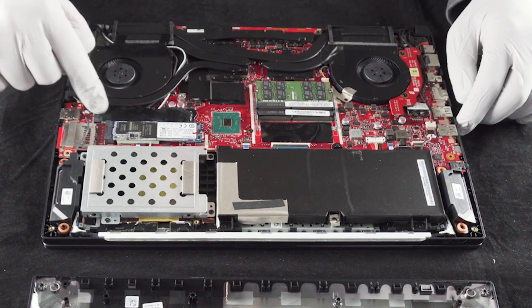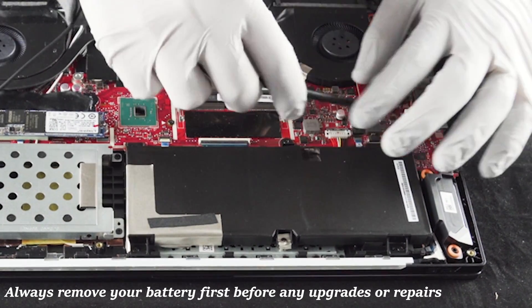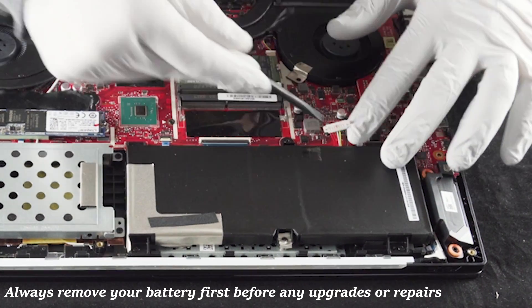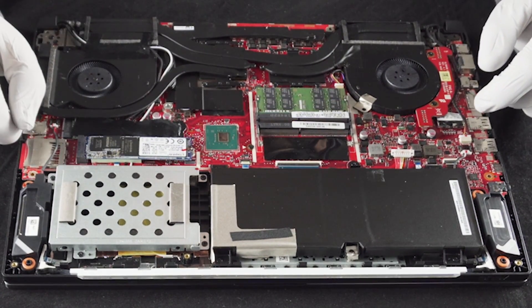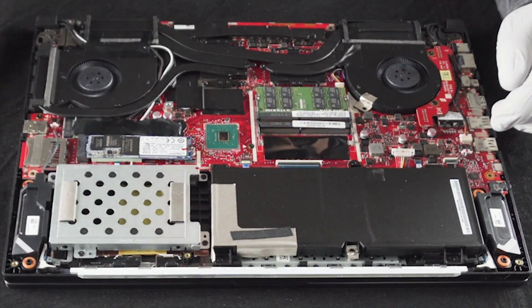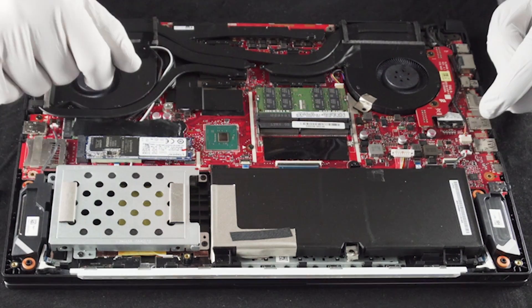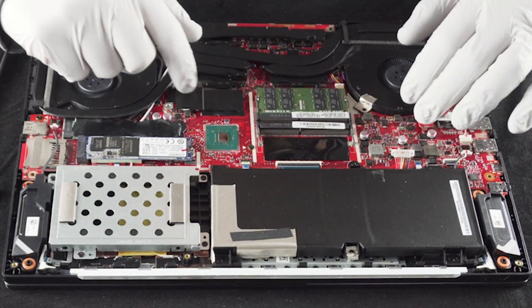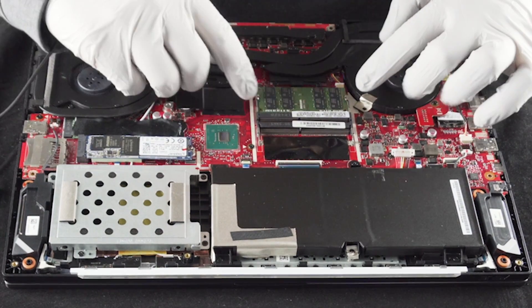Looks like our Wi-Fi is covered up by fabric tape. All we're going to be doing today is upgrading the memory. We're going to go from this single channel configuration — it does have a little clip on it. As you can see, it's in a single channel configuration. This is how Asus and a lot of manufacturers this generation are shipping laptops, and it seems to cause major performance issues in games, particularly in CPU-intensive titles. What we're going to do is take out the single 16GB stick and put in two 8GB sticks to enable dual channel. That's going to fix the performance issues we've been experiencing. Let's get to it.